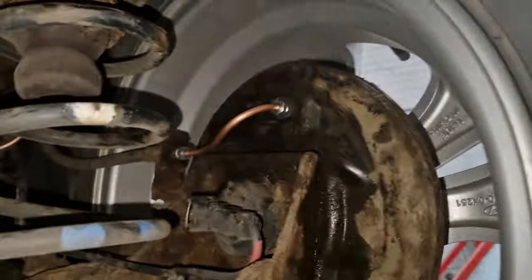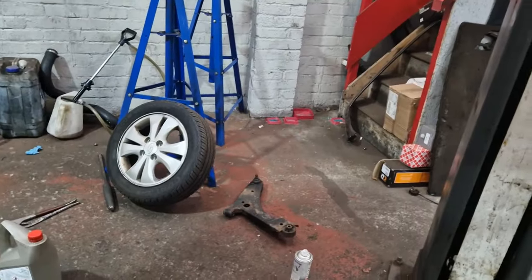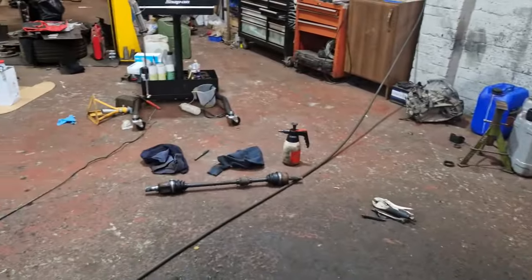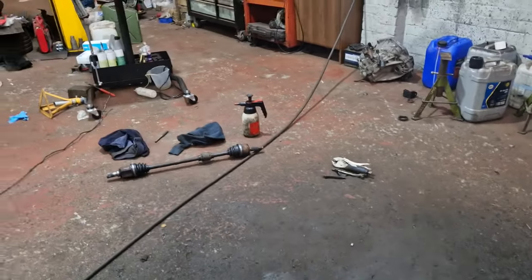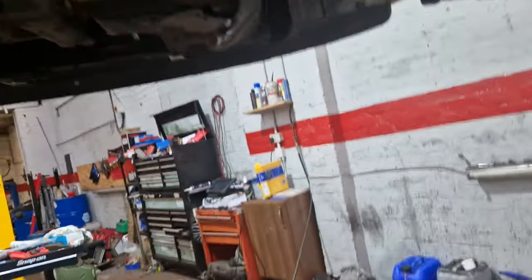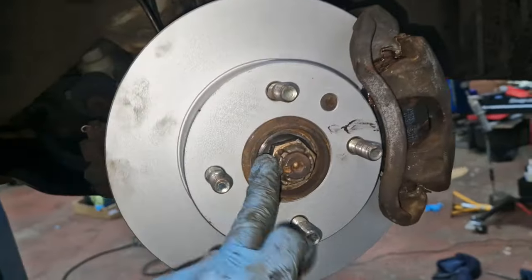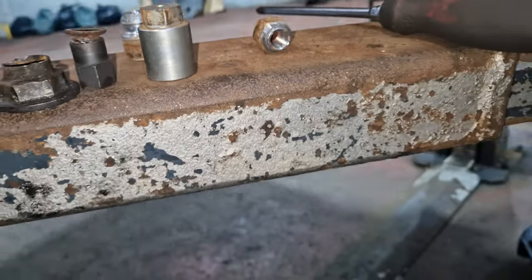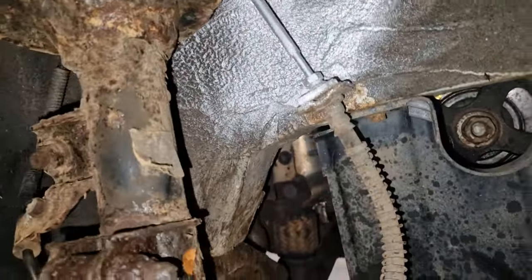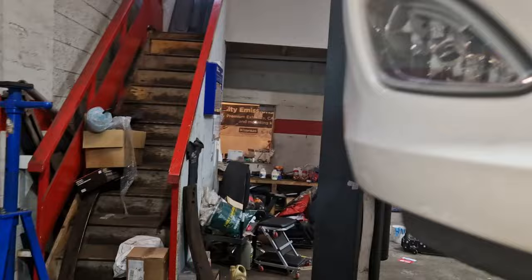I just need to tighten those wheels up — no drips there. Cut out the cable tie. Just the brakes and the suspension arm, which is lying over there anyway. I've never had to cut one off — we would have had to cut that nut but we managed to get it. Nearly there. Pads and discs all greased up, and I put a new hub nut on there. That's the pinch bolt — no end of grief getting that off, everything's been no end of grief on it. Cleaned and painted that brake pipe — some zinc, same on the other side. Still got the pads and discs to do on this side, still need to top up the brake fluid and the gearbox oil. Nearly there.